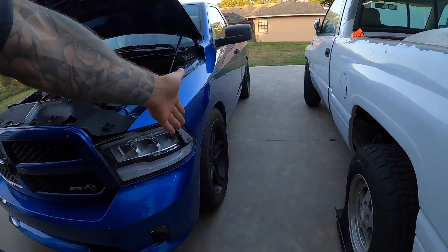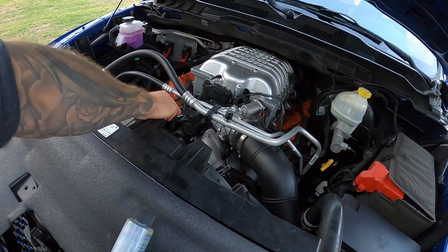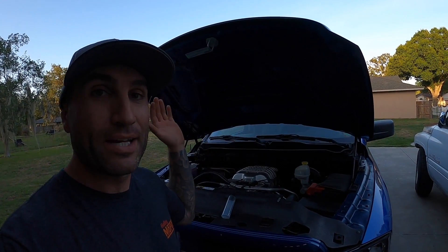The plan is to put the drag pack back on and get to the track where this thing should be really fast. We also overbuilt the fuel system, so whenever we want more power we just need a smaller upper pulley - currently running a 2.85-inch, and guys are running smaller than that for even more power. To summarize the E85 Hellcat protocol: data logging with your tuner, flushing the fuel system, bigger injectors, more fuel pump capacity, and colder plugs. Give it a thumbs up, check out the other videos for the full build, and see you on the next one.